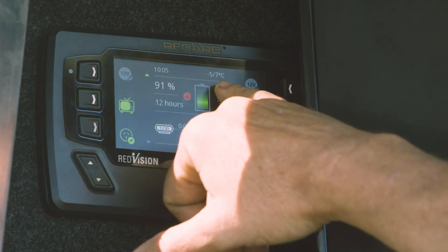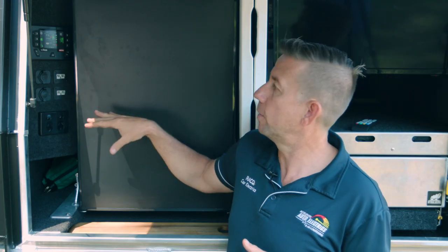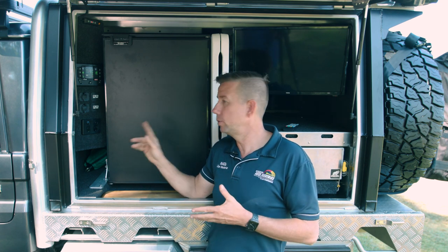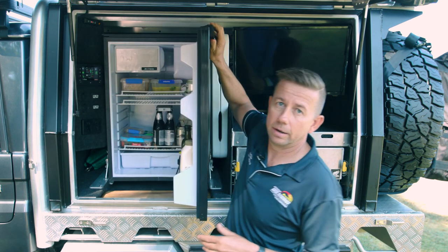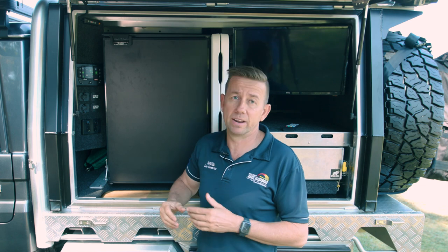The other thing I forgot to mention is the temperature sensors — my freezer is currently sitting at minus five and my fridge is sitting at seven degrees. We've had the door open a few times and we've just popped a little hole in the side of the fridge — you can do this on these Bushmans — with a sensor in both, so I can see that while I'm driving and know my fridge is cold and everything's good. On the fridge — I went the Bushman 130 because it's the biggest you can get into these canopies height-wise. I'm all for an upright fridge even though it uses a bit more power — you can just open the door and everything's there, easy to use and a lot more accessible. You do need to think about how you're packing it for off-road, but Tupperware containers and smart stacking and I really haven't had a problem.